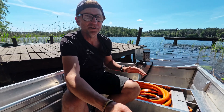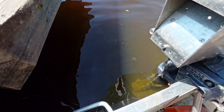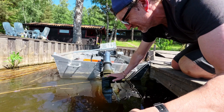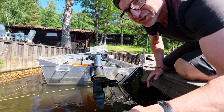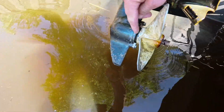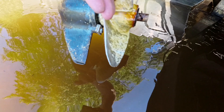If we compare this build to a normal two-stroke, we think it's probably about the equivalent of a six horsepower. This lower unit has been put through the works and is not all that efficient anymore. A couple of weeks ago I came out here and the motor just wouldn't turn around — I understood it wasn't anything electronic, it was mechanical, and there was a failure down here in this piece of the casting. What had happened was that it had bent out like this.